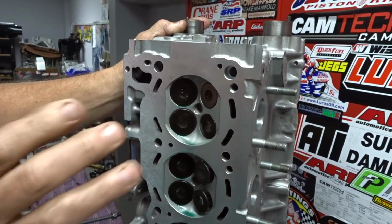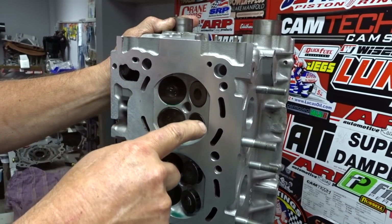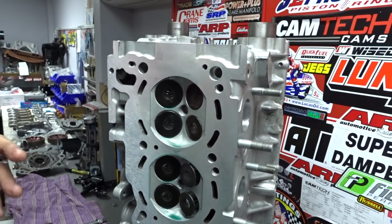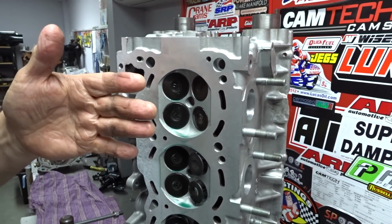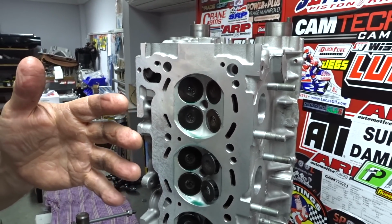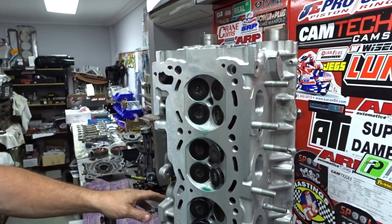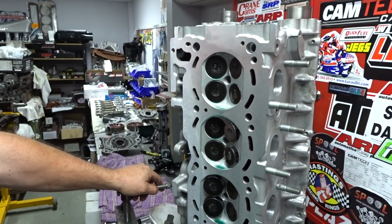So if you take these quench pads off, when the piston comes up it doesn't compress, so it's trying to compress in a big void and it's just going wherever it wants to. So what you have to do is spark the thing real early to get it to burn. And then it's a heap of shit of a motor when you do that. As soon as you've got to spark it early, you're putting load on parts like conrod bearings and pistons, just to get it to feel lively in the car. It's bad, so leave the pads on there.